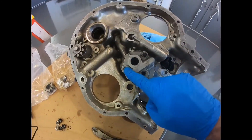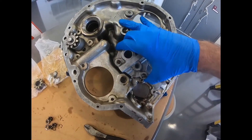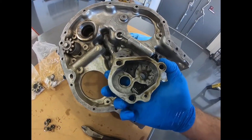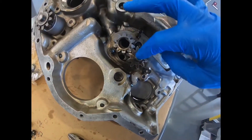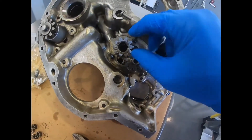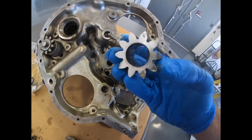All right, once you've removed the nuts, the safety wire, the nuts, the oil pump housing essentially just slides off. It's an aluminum housing. And then below it are the two gears. The oil pump gears are individually machined parts; however, you can only buy them as a set. This is the one that's suspect because the shaft has been worn. You can look inside there and see the wear spot in there.